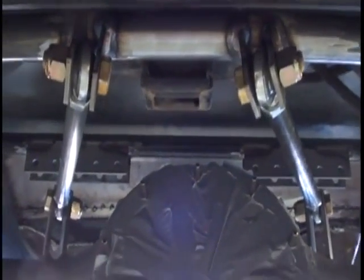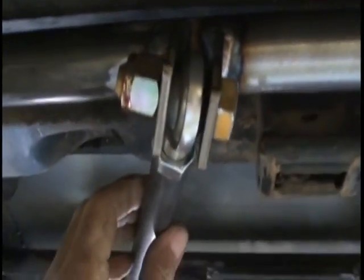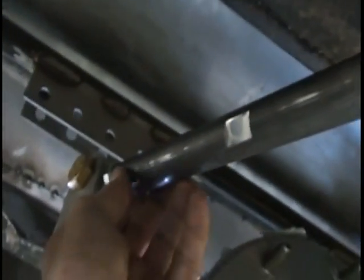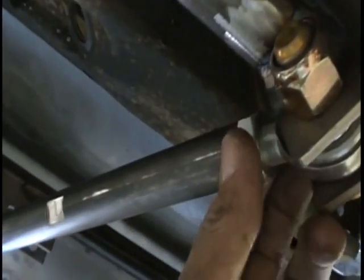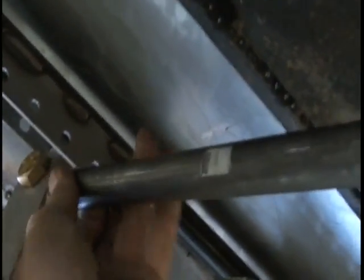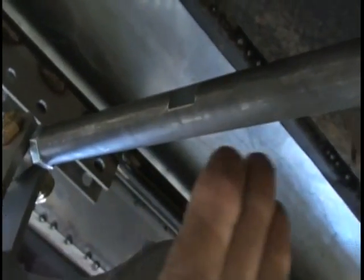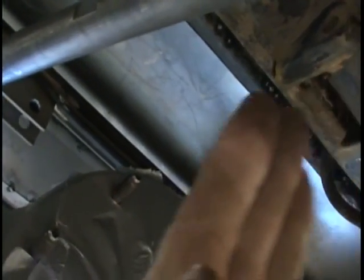Okay, I have our upper adjuster bars installed. I've got them tightened down. This is what we use to set our pinion angle, guys. These are right and left-handed rod ends. You'll break the jam nut loose on both ends. One turns left, one turns right, and then you turn it in the center. That'll pull the top of your housing in or out depending on your pinion angle.